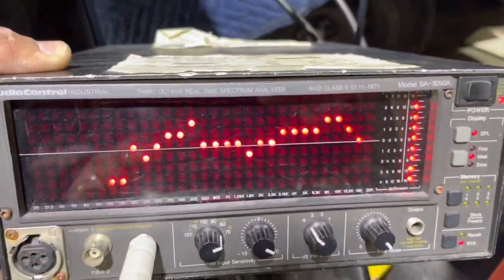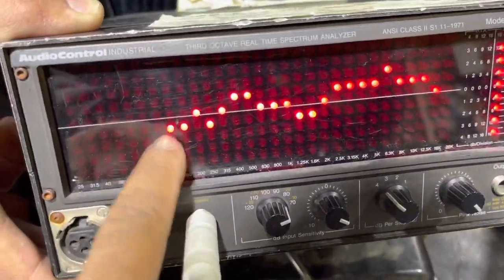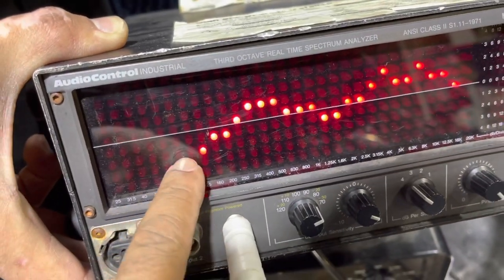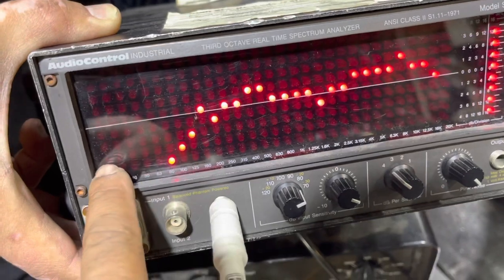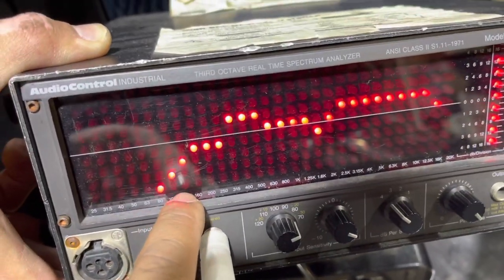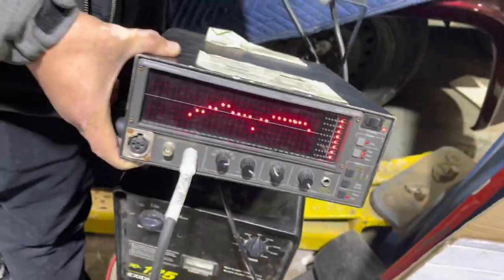But we're playing pink noise to the radio. We have nothing below 125 hertz, so we have no bass at all. We have no bass because from the line leveler, we have nothing below 125. So fine, they use the line leveler.